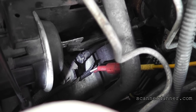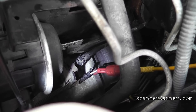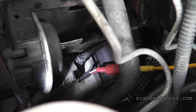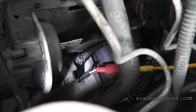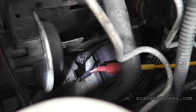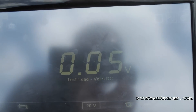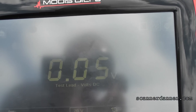Keep in mind we did have a fault code for a transmission range switch — P0705. That doesn't necessarily tie in directly to this because the starter interrupt part of the park neutral circuit is a non-monitored circuit. But there was a fault code for it. So let's get a voltage reading here while cranking. Remember, we're good going in on our yellow wire. We're now on the purple-and-white wire coming out. Here we go — that is the crank position — we got nothing. So what we have is a park neutral switch problem.